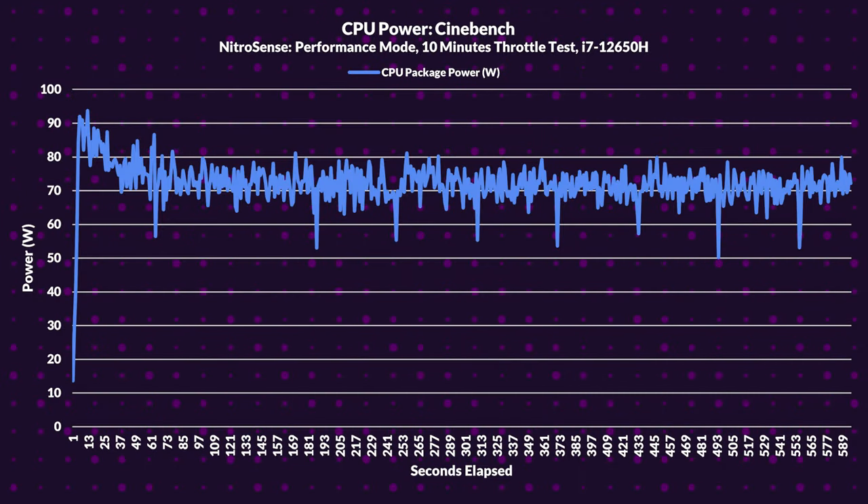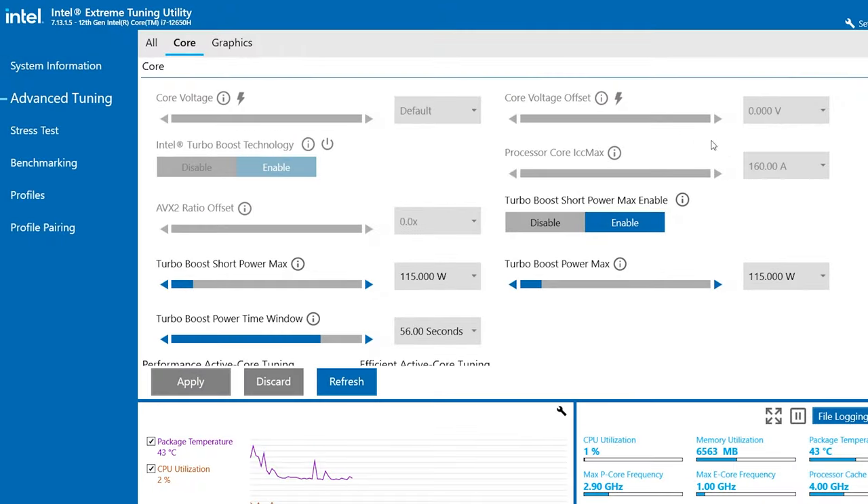The CPU's power consumption peaked at 94W during our Cinebench tests, further confirming these thermal issues. Improvements could have been achieved by providing larger fin stacks with more surface area, ensuring balanced cooling for both the CPU and GPU, and optimising voltage management. Unfortunately, on these newer models their ability to undervolt has been locked out. Acer's thermal design leaves much to be desired, and it's a missed opportunity to deliver a better gaming experience with improved cooling.